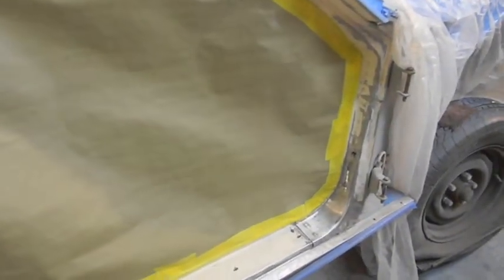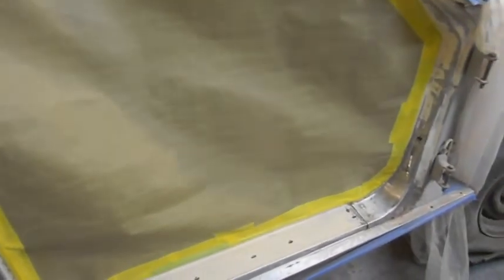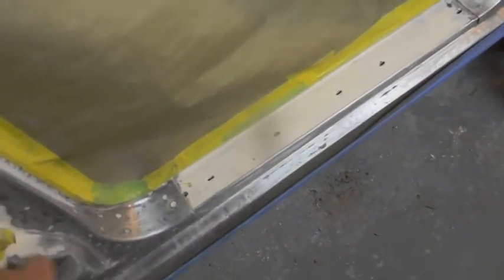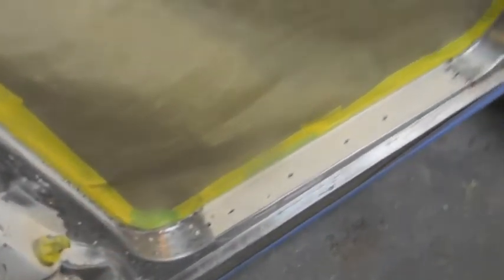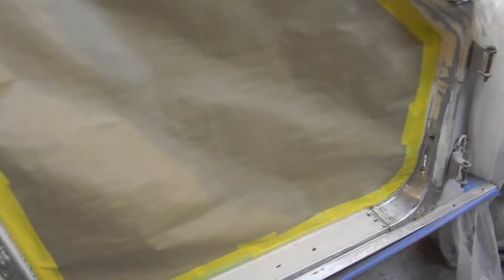I mean, when I'm done, I'm definitely going to go over it. I'm going to start going over it in little areas. But I shouldn't have to strip too much more. Just, I'm going to get here. I might as well get that paint off. Whoops, over here. And that's it. And we'll come hit it with a finer grit and a Scotch-Brite pad. Make sure I got no shininess anywhere.